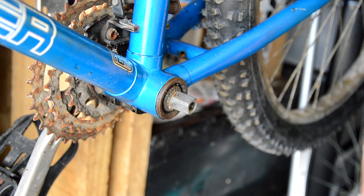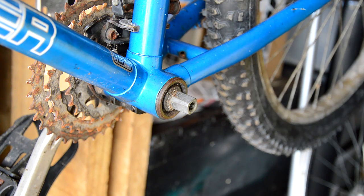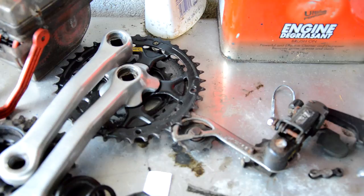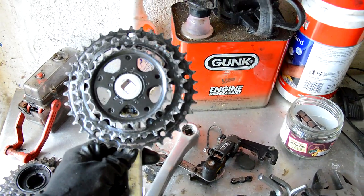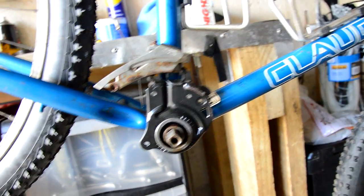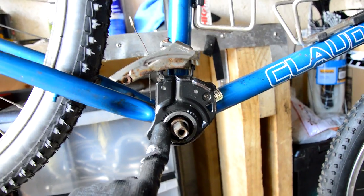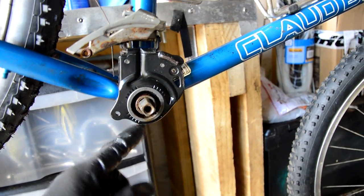So just like that, there we go. What we've got is a cartridge - it's a sealed cartridge bottom bracket, actually Shimano Altus branded. The part code reads BBCT90, 68mm shell, standard 1.37 by 24 - standard bit of kit. It's just slightly different because of the E-type derailleur mounting, but I'm going to look it up.